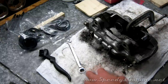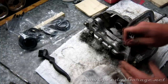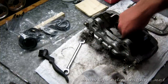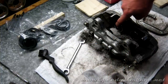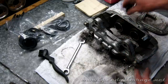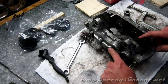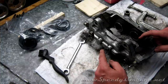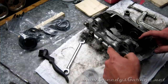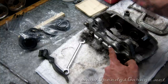This is going to be a messy job — it's not technically difficult, but it is a little bit tedious. Once you get one cylinder depressed, you can remove the clamp and the socket and move on to the next. You're going to do that for all four to get as much fluid out as you can. The next thing you're going to do is remove these dust seals using compressed air. You're going to remove the connection where your factory brake line comes in, put compressed air there and push the pistons out until you can just take them out of the caliper.